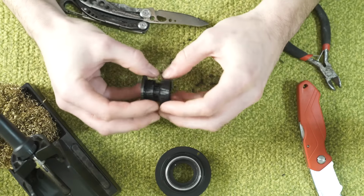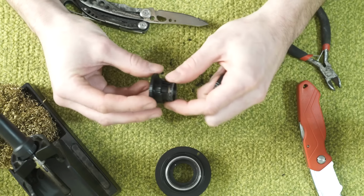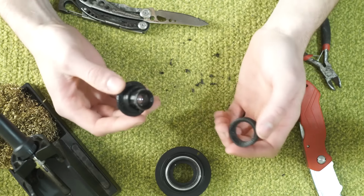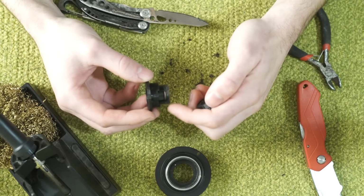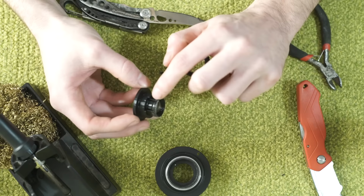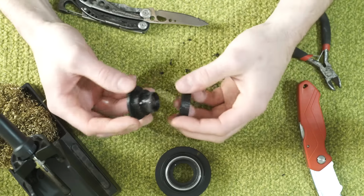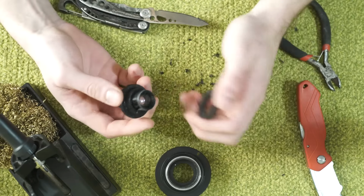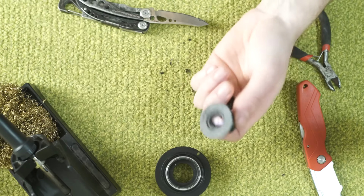All right, now with that sanded, it feels like I can force fit that on, but of course I don't want to do it until it's in there because I don't want to break these components getting them off. These are not built to the same grade that a standard lens would be built to, of course. These are all relatively fragile plastic. Some of these 3D printed sections are about 1.5 millimeters thick. This vertical section here is only about 1.5 millimeters thick, and that makes for an incredibly weak print. That being said, this will be just fine because there's no load on this. This lens weighs almost nothing. It's never going to be struck against another object. And it will see a relatively easy life.